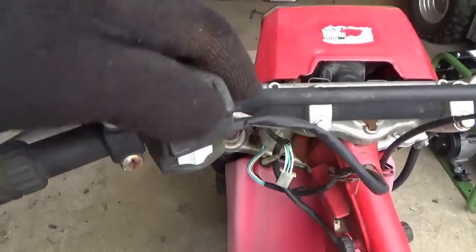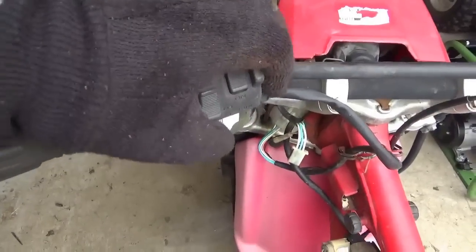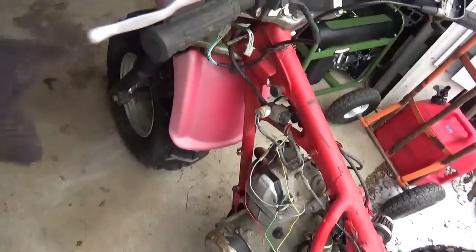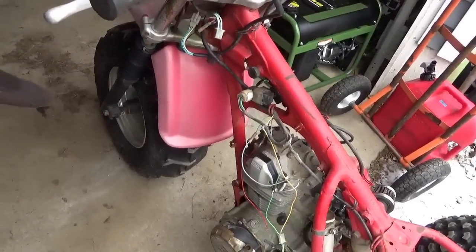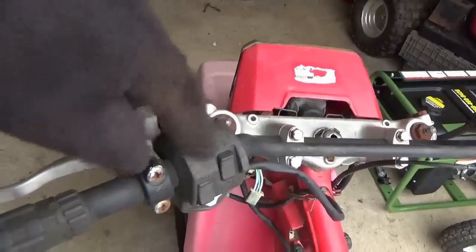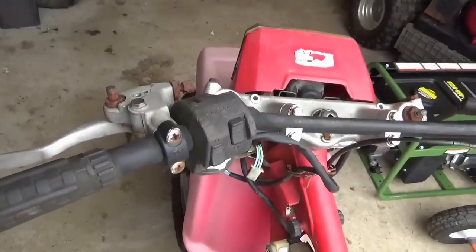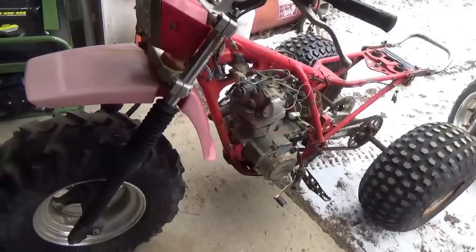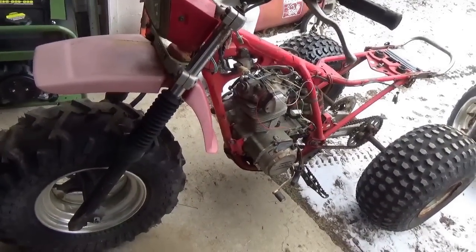It's very hard to move things and turn them on and off. The stator coil for the lights appears to be good, and the lights appear to be good, but nothing seems to be coming through the switch. So I think the switch is done — I did some troubleshooting there.